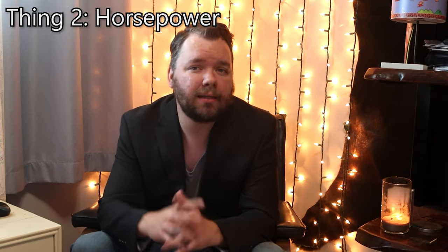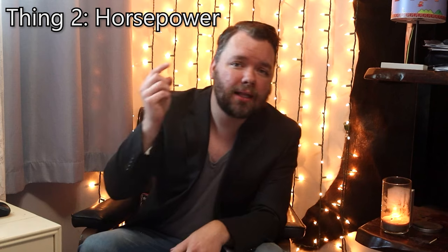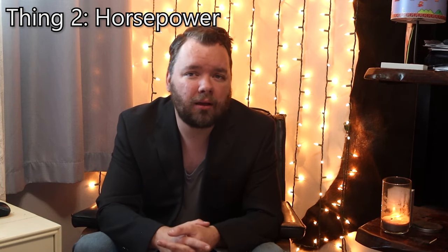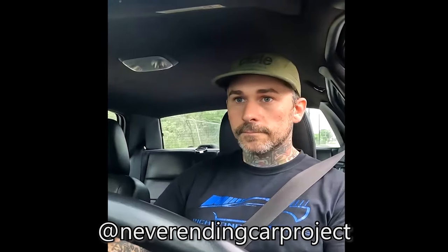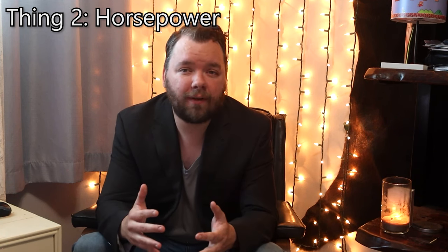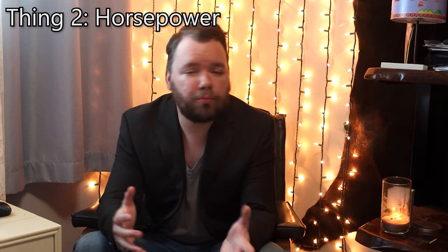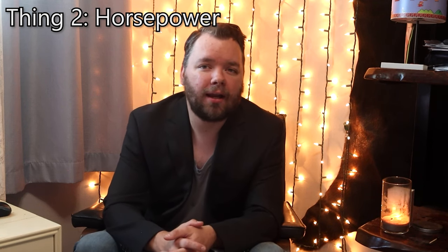The second most popular thing people look for is horsepower. Horsepower is slightly difficult to get out of the 4.6 — I've made an entire video about the 4.6 two-valve motor linked in the description. The absolute basics: if you want to boost it, you're going to make roughly 450 horsepower whether it's a 5.0 or a 4.6. You're going to cap out around 300 horsepower for the 4.6 or the 5.0 if you're not boosting it. For the 4.6, you'll want an NPI to PI hybrid. For the 5.0, you'll want a super-cammed GT40 5-liter motor with some sort of torque converter.